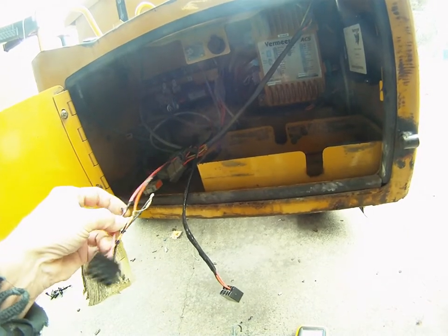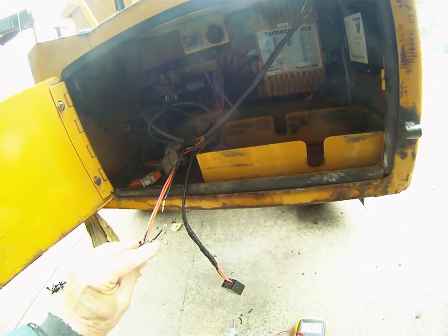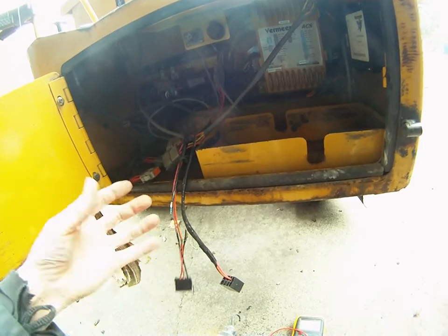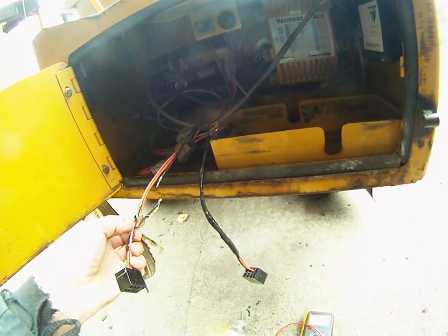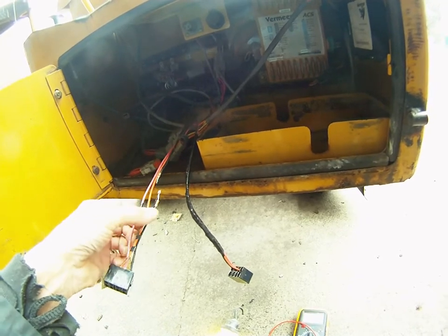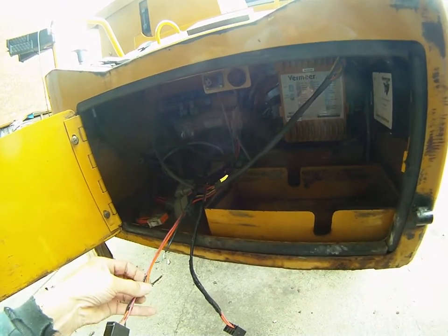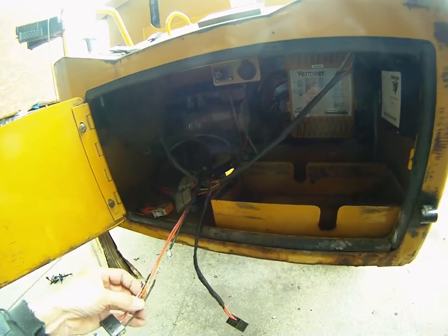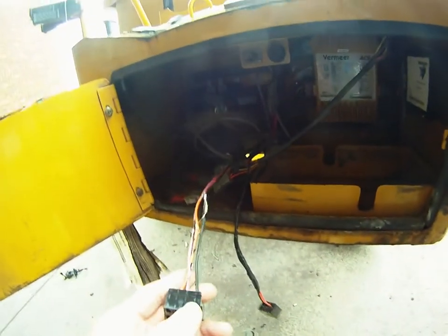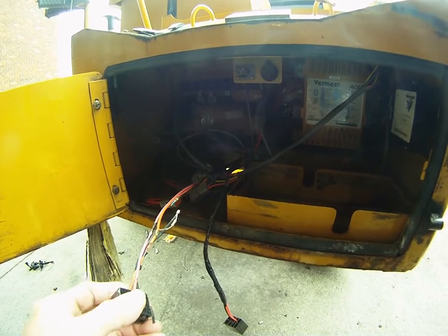So there are obviously more of these nasty resistors inside the harness. It's a multi-strand cable as a harness would be, so it can be flexible and handle vibration — and these components are single strand, designed to be on a printed circuit board or PCB, not in a harness. If you had single strand wires like that little resistor in all of these wires, they would just crack and break in no time, rendering the whole machine useless. It is the weakest link.